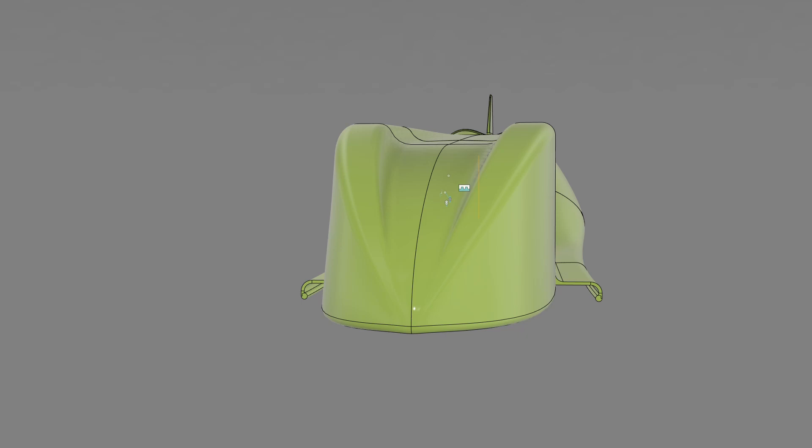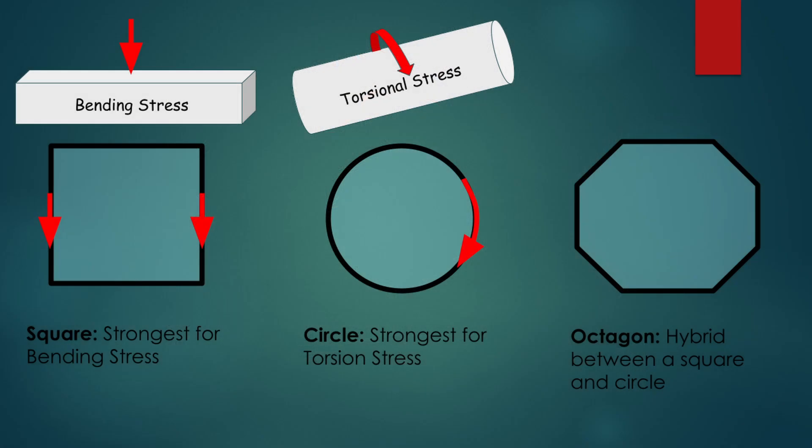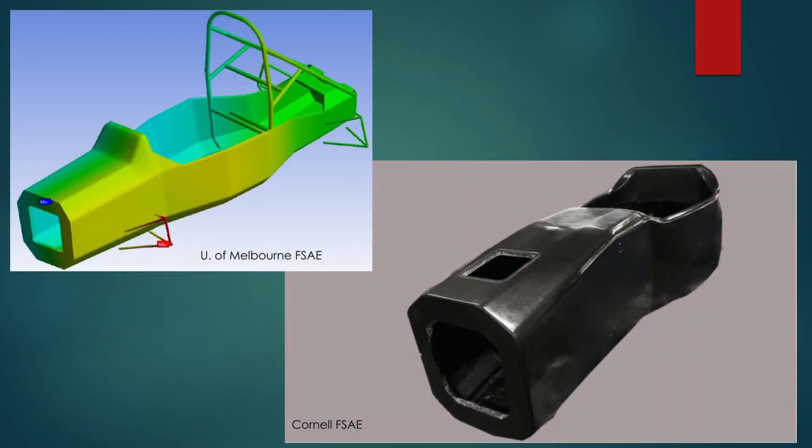So the Streamliner can be a purely square profile because it has very little torsional or twisting stress. But the hypercar has a wheelbase that's much wider than the monocoque and it'll be taking hard turns, which puts a lot more torsional stress through it. A circular tube is the most efficient shape for handling torsional stress — this is why sway bars and torsion springs are typically made from circular tubes. Since the monocoque needs to be strong in both bending and torsion, we need a shape that presents a compromise, and that's typically an octagon profile. By tweaking the ratio of squareness to roundness, we can tweak the bending versus torsional strength characteristics.